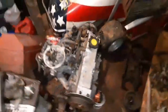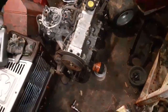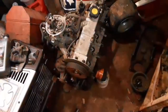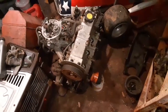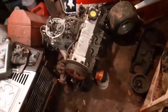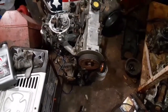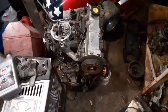The engine, for some reason, it didn't when I first started messing with it, but now when you spin it over with a wrench, it acts like it's only got one good cylinder. I'm going to guess that some lifters went down. You know, it sat for a long time without running, and then I was turning it over. So I'm guessing that a couple of the lifters went down. We'll see. That, and I had to add 2 quarts of oil to it. And it don't seem to be leaking anywhere. But in the next video, we'll do a recap on this stuff, and I'll show you more.